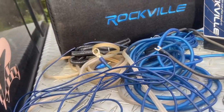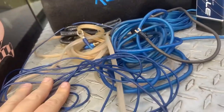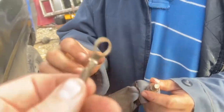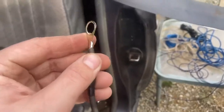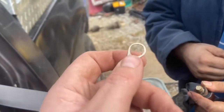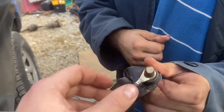I'm going to use some nice wire loom and get some electrical tape and wire crimpers out of the toolbox. I wanted to put it on a good ground, so I figured I'd put it on the seat belt bolt — that's a good ground. This one was too small, so after filing it for about 20 or 30 minutes, it slides right on.